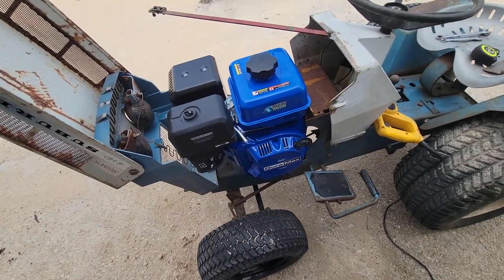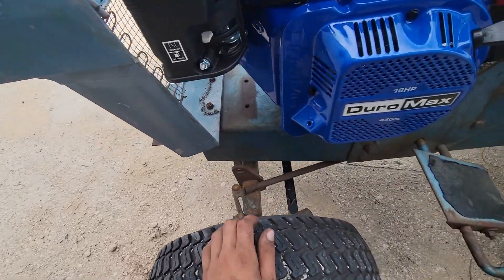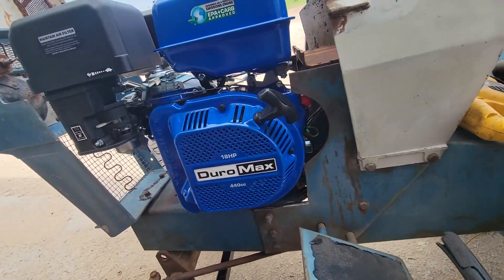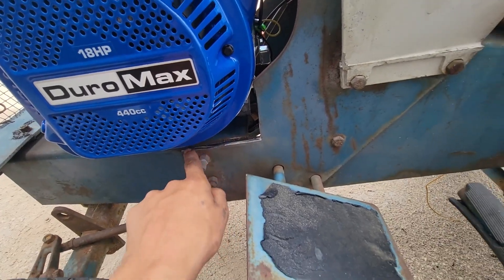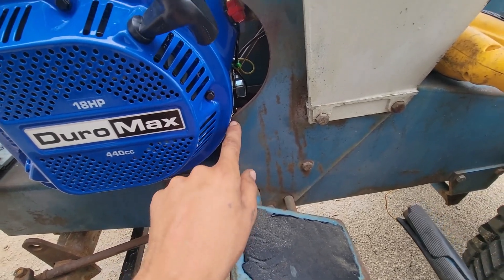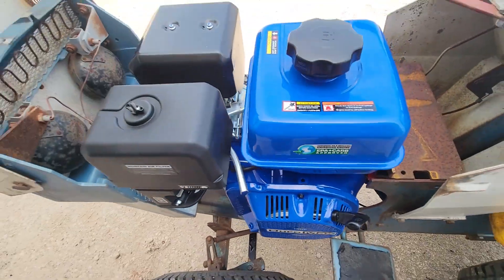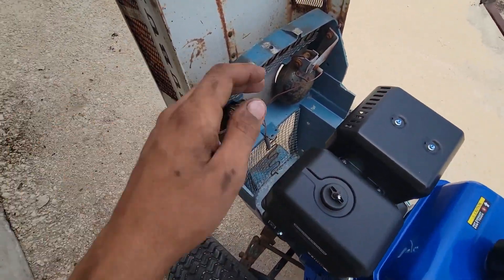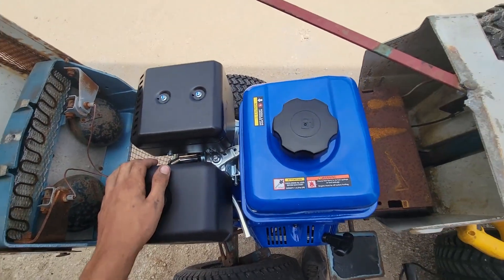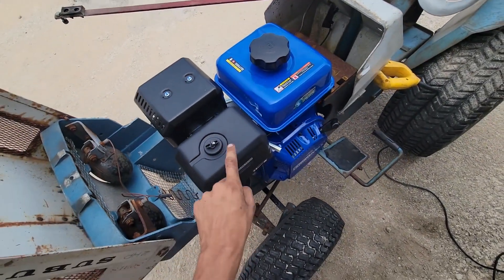These engines just really don't fit in here very well — the bigger ones. Something like a Predator 212 fits in these great, but anything larger just doesn't fit. So I had to cut the frame, which I'm totally against doing, but I guess it had to be done. Cut it right there and right there just to make everything fit a little bit nicer. It seems to kind of fit, but if the hood is moved back all the way it does just bump the side, and the engine still has to move that way.